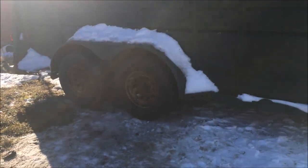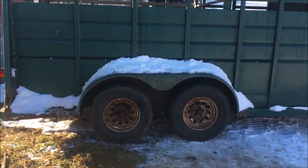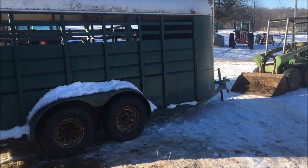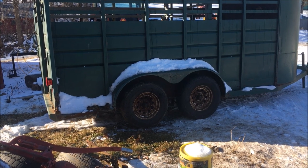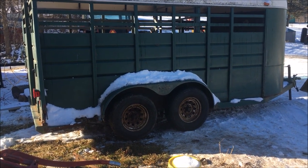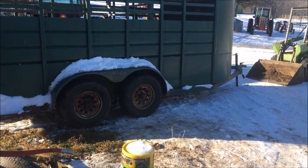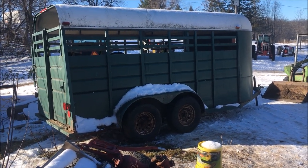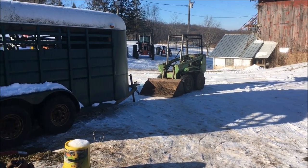We've got the old cattle trailer sitting back on four wheels again — not too bad. Just to review: I bought this trailer on an online auction and paid practically nothing for it because it had the broken axle, just slightly over scrap price. Other than things I already had laying around, I bought that one spring pack and the u-bolts to clamp the axles onto the springs. I've got about 60 bucks out of my pocket wrapped up in this thing. I like to think that would make my frugal Irish ancestors proud, and hopefully the engineering would make my German ancestors proud.